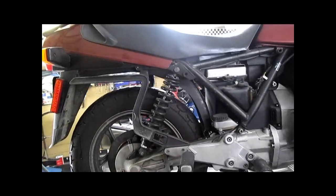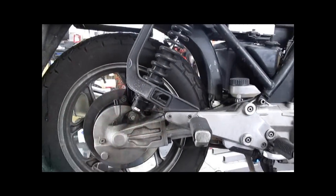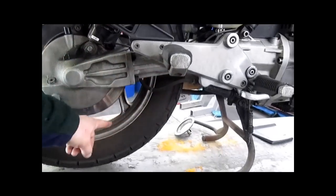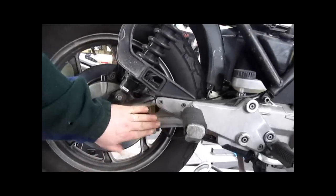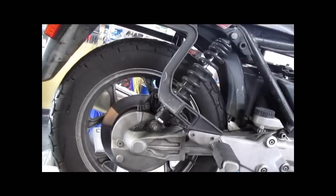Hi, so you're considering the purchase of a BMW K75 or a K100 model. One thing you absolutely want to check before you make that purchase is the splines on the rear drive. Now this only applies to bikes with a mono lever rear suspension, like this one. If it's a para lever, you'll have another torque bar down here and a long part of the rear drive here. Those don't apply to this. This is strictly for mono lever bikes. These mono levers will eat these splines if they're not maintained properly.